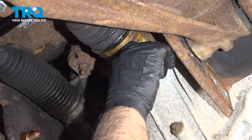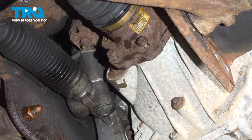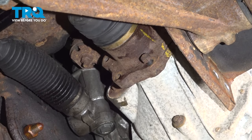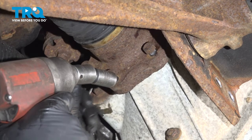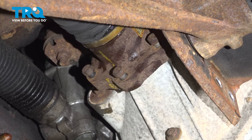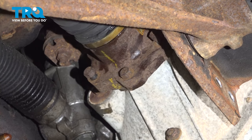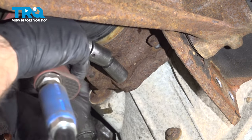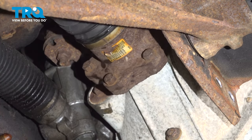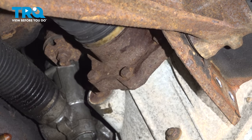Now make sure the axles are lined up the way you took them apart. Get the bolts started and go all the way around first before you tighten them down. Now tighten these down — start on one side, just snug it, then spin the wheel to get to the complete opposite side and tighten that one down. Then go around again back to the one that was snugged and start tightening them all down. That's all of them — do the same on the other side.